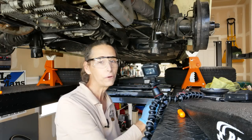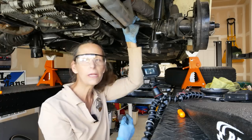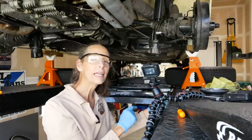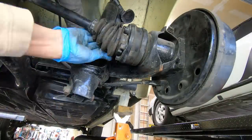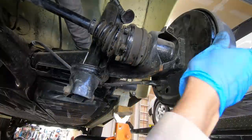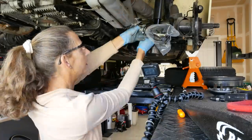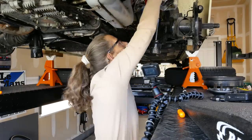I'm a little out of order here. The problem is that once you have the wheel off and the brake apart, there's no way to lock the axle shaft down because the differential just spins whether it's in gear or not. So I put the drum back on, quickly refitted the pads, pulled the parking brake on, and adjusted the stars to lock it back up. We really don't want anything getting into the back of the CV joint, so I've got a bag to pull it out and cover it. Zip tie or bungee cord it up and out of the way.